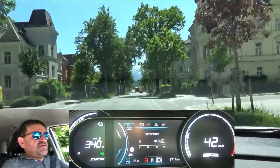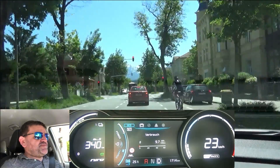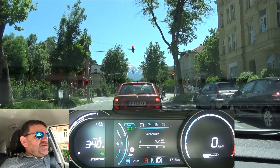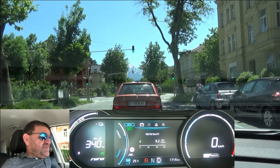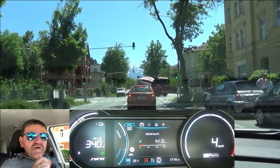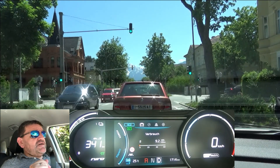As an example, you can see that the traffic light ahead of us is red, so I'm lifting my foot off the accelerator and the car is coasting towards the red light, losing almost no speed. Of course I need to come to a stop as the light hasn't turned green yet, but I'll try to brake as little as possible. It might seem appealing to brake a lot since you get energy back into the battery, but the crux is that in order to regain energy you need to invest energy beforehand, and as we found out in our mountain and regen test — link below — you'll never ever get back what you have invested.